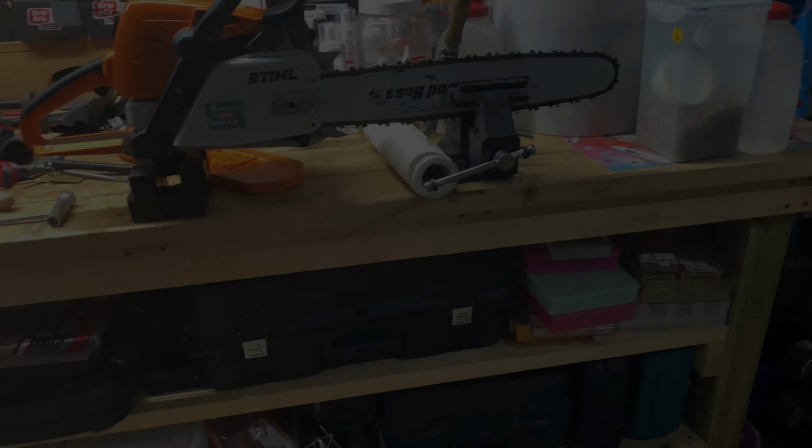And your Stihl manual should give you the right instruction. The Stihl filing kit should come with, again, more help. The primary sharpen is usually 30 degrees. You'll need a flat filer, a depth gauge, and the sharpener filer itself.